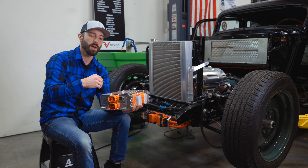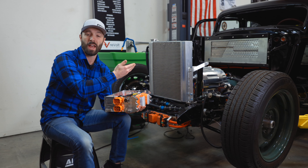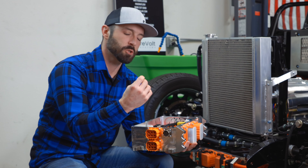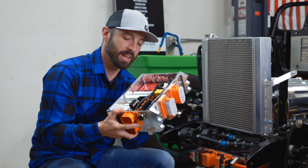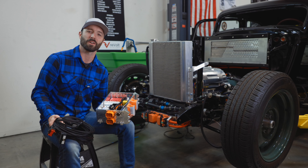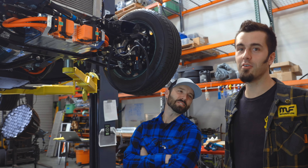The main reason we wanted to make our own PDU is we needed it buff enough to handle the demands of not only the Revolt motor but a lot of the creature comforts and the variety of controls from either your battery management system or analog inputs from your cabin — for example, turning on AC. We made sure the low voltage plug has both high and low coil control, so a BMS pull-to-ground and your cabin's pull-up positive toggle switch both work. When you buy a Revolt motor it comes standard with the wiring harness, and if you also purchase this PDU contactor box separately, that's everything you need to plug and play and get a powertrain running.